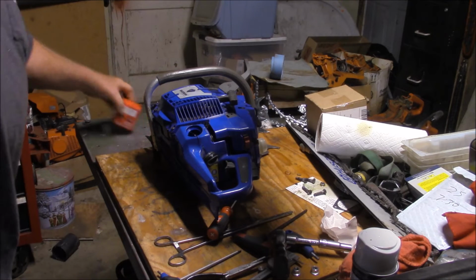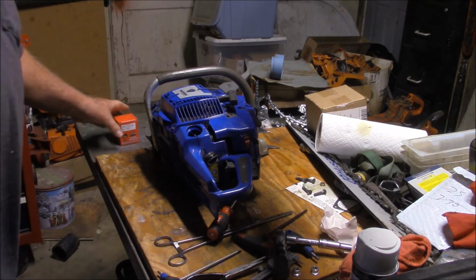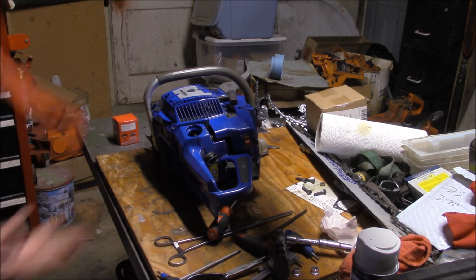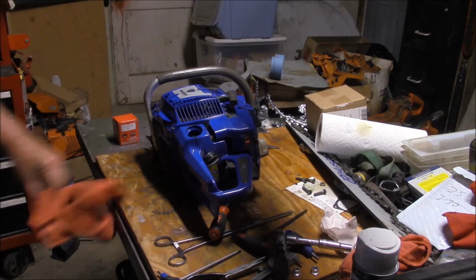And this piston here that I got in that box only cost me like 40 bucks delivered. And using the same gasket, a little bit of elbow grease, and 1184, you might want to do that anyway, because you get a better piston with a pop-up, you're going to get a little bit better performance.